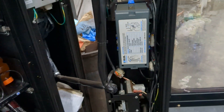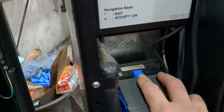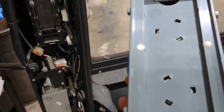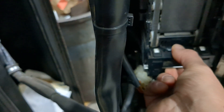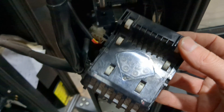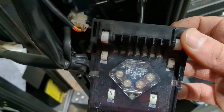Number one: turn off the power. Whenever you're unplugging or doing anything, turn off the power in the machine. There's the power switch. To lift the bill box off, push that tab in and it pulls right out. There are sensors in here that have to be cleaned. This metal bar right here will lift up, and you just pull this lower section out — very simple. It's plugged in so it won't come completely out, but this is where those sensors are.